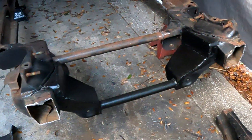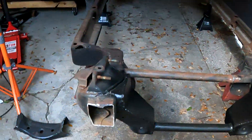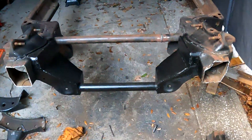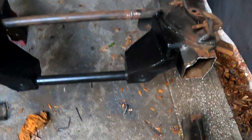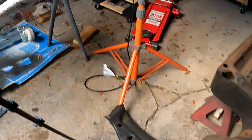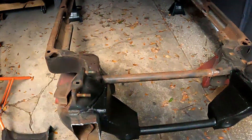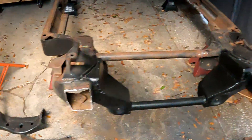While the body's off, it's a lot easier to get all this done. With the notch, you've got to be very careful of how close you're cutting with your control arms. A friend whose design I've mentioned before — this is one of his front-end designs, and I like it — it's nice and neat, leaves a lot of room. Once we tube around it, we'll build our mounts for the fenders and to hold up the front header panel and bumpers. I'm going to pick a point that's the same on both sides, take a measurement, then square them off and double-check that the frame is level in both directions.